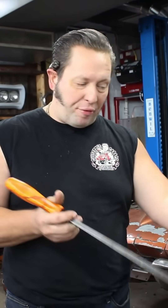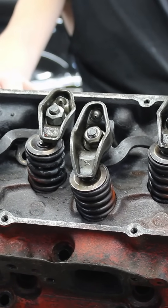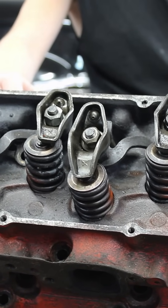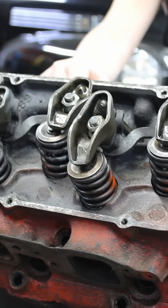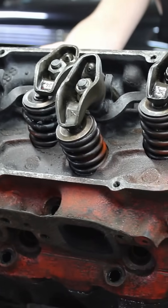So now I'm going to show you whether or not it's interfering. This cylinder — the piston is all the way up, top dead center. See how the exhaust valve's opening? And that's with no oil pressure, so this should be opening even more than that. That's about the peak opening measurement of the exhaust valve.